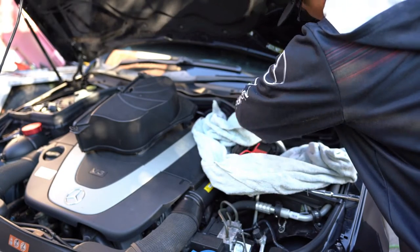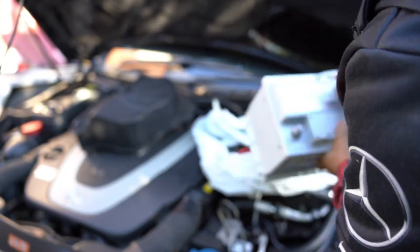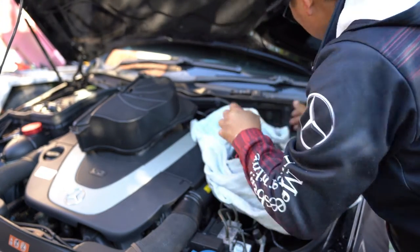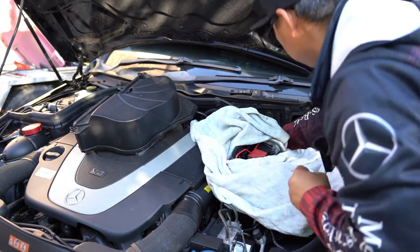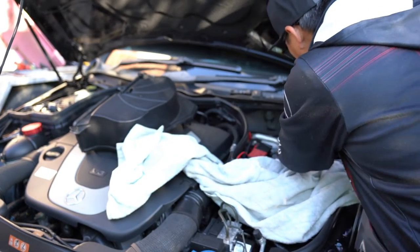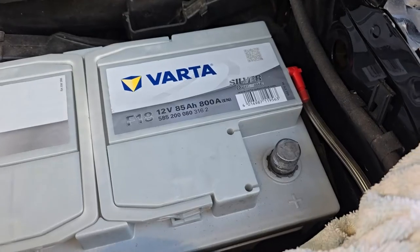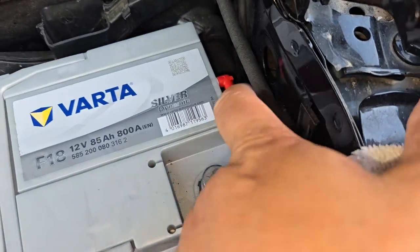Now I'm just going to bring the battery over, move the cables out of the way, and place the battery in. I'll cover the terminals just to make it safer as I maneuver it into position. Move the battery around until it sits in place — it may take a little wiggling depending on how your cables are positioned. Make sure you push all cables out of the way first. Then push the air tube on — really simple, it sits all the way in just like that.